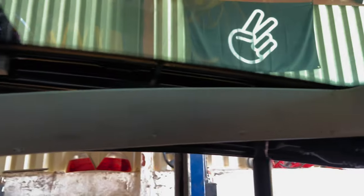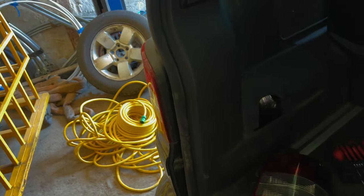I've got a confession — I kind of did it on the wrong side. When you look at the grommet for the wiring loom for the tailgate, it actually comes out on the passenger side of this vehicle. I got all excited and went ahead instead of thinking about it. The wiring needs to come along here, through here, into this grommet or conduit, and then down on to the passenger side. As I've already crimped those connections onto the wiring on this side — which was stupid — all I'll do is extend these wires. It's just two bits of wire. Check, check, and check again before you cut anything.